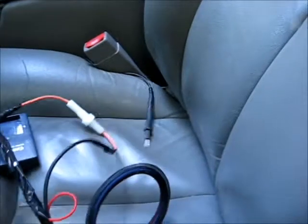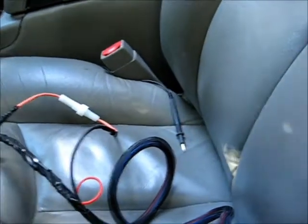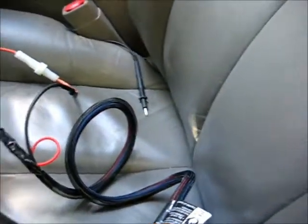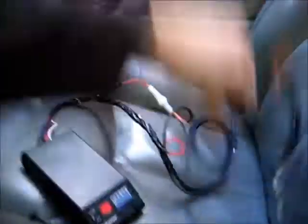Now if I don't need to use it anymore, I just push on the tab and she comes right off — quick. So there you have it. There's a 30-amp fuse in there — should be a circuit breaker but I might change that. I'm only moving an air trailer this Saturday or Sunday. I was looking at those 30-amp spade breakers today — breakers would be better than a fuse. Put the nut back on — that holds the plastic cover on.